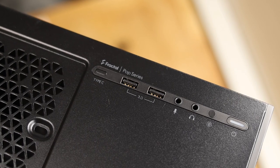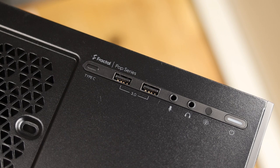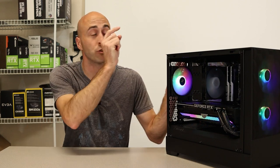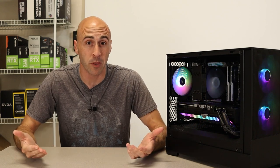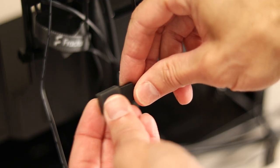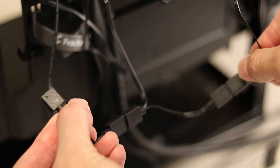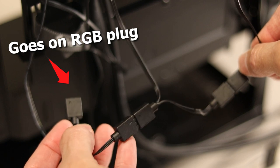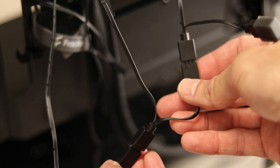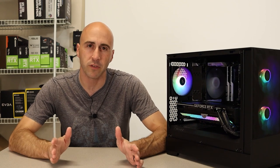The I/O is also mounted on the top. You have one USB-C slot but it's not included — you've got to buy it separately. You have two USB 3.0 Type-A ports, a separate microphone and headphone jack, a multi-function RGB button, and the power button. To hook up the RGB so you can use that button to control your lighting — first remove the red cover. Each fan has a male and female RGB connector. You'll daisy chain them together: the front female connector goes onto the male connector under the red cap, then the male from that end goes into the female of the next front fan. Then connect the female from the rear fan into the male of the second fan. For the rear fan, keep the male end with the rubber cap tucked away inside the case.